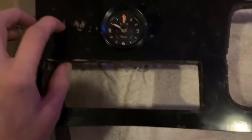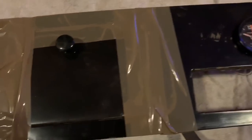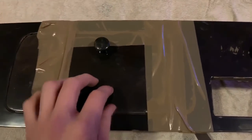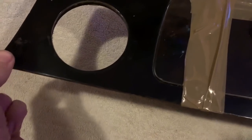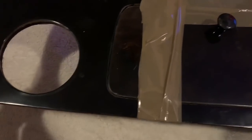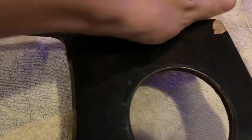There's a little bit of a crack just there. The hinges are all there, the latch isn't for the top, but I can get in and that's not an issue. The hinges all look okay. I'll just take this tape and have a look at what's underneath it. On this side too, the laminate's lifting off. My plan is to put some wood glue underneath these — I think wood glue will probably hold it down, if not maybe some super glue. In regards to the chip here, I'm going to get a small bit of body filler in there, break off the loose bits, and give it all a sand. Then it can be ready to take some primer.